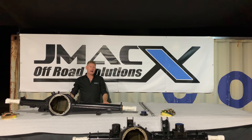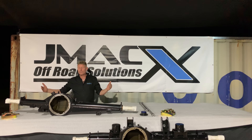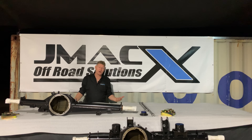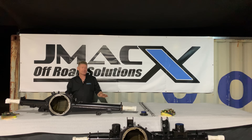The issue we see with the 70 Series Land Cruiser — on the new V8 models from 2007 onwards — is the rear diff is roughly 100mm narrower than the front. By widening the rear differential to match the front track, we do a couple of things: we increase the stability of the car, and we also match the wheel track when you're off-road, in sand, wheel ruts, or whatever. Having matching wheel tracks — just as you would with an off-road trailer — has a huge benefit.